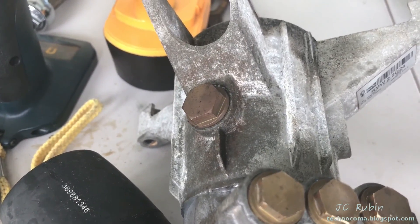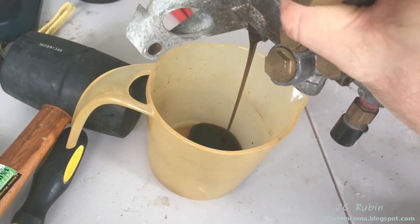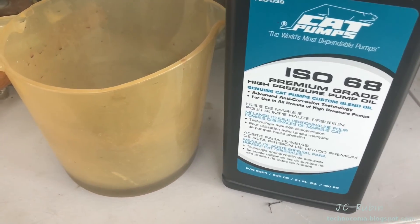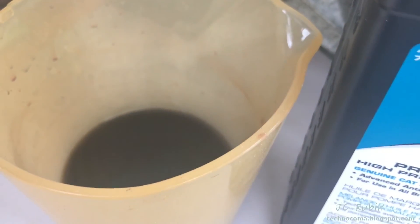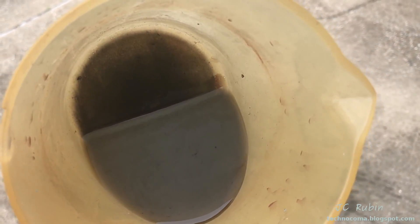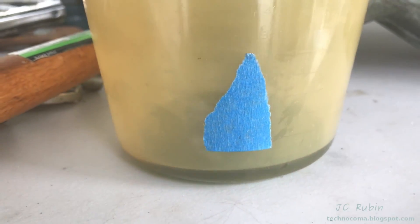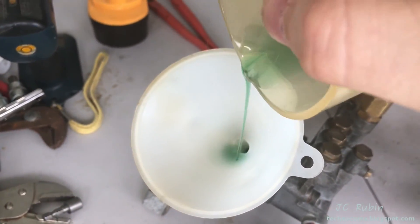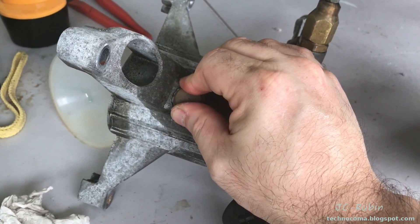One more thing for those wondering — since I'm here and it's been 10 years, I'm going to drain the oil and put in some new pump oil. I'm going to mark this line, drain it into my oil tank, and then refill it with fresh oil, then put it back in the unit. This oil smells like an old teletype unit — really cool. Snug this down and we're done.